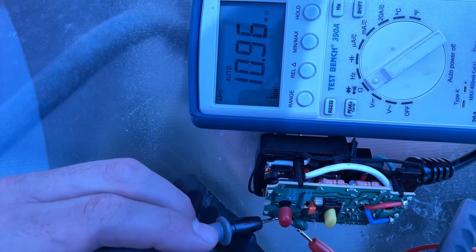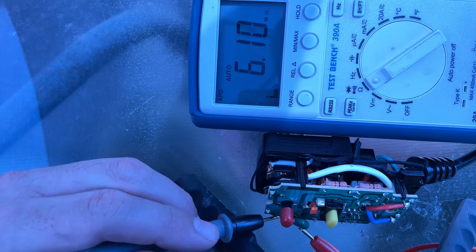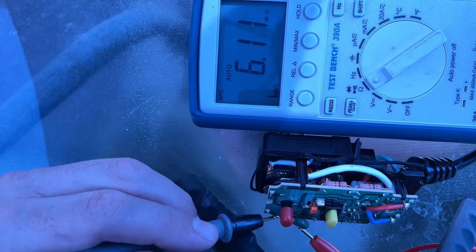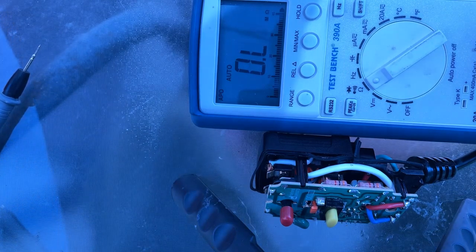Right now, normally when you test resistance on a capacitor, if the capacitor is good, then it should slowly but surely raise in its resistance to a large value, because the internal parts of the multimeter have a power supply that tests for the resistance of something. If the capacitor is good, like this one is demonstrating to me right now, then it should be charging up to the point where it would eventually get to an infinite ohm resistance.